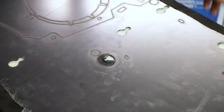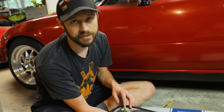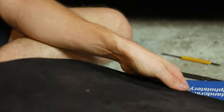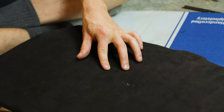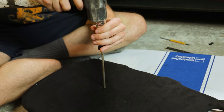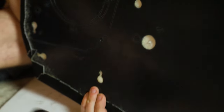The larger punch cracked it and let me lift the piece out easily. Now that one's done we move on to the next one — we'll cut the fabric as one of the last steps. Same thing as before: drill a small hole. This one's a little tough since it's tiny and the fabric being on there makes it more difficult. Cup the hole we drilled, poke it through the fabric for a reference point on the other side, flip it over, and use something bigger so the whole piece pops out rather than just piercing it. Give it a good tap and the piece comes out.